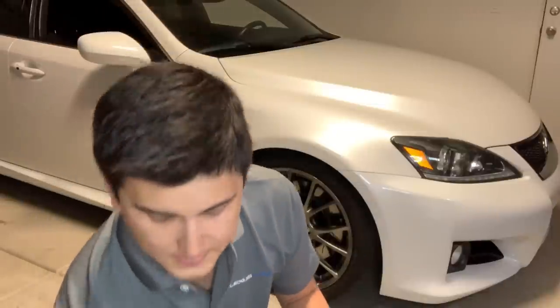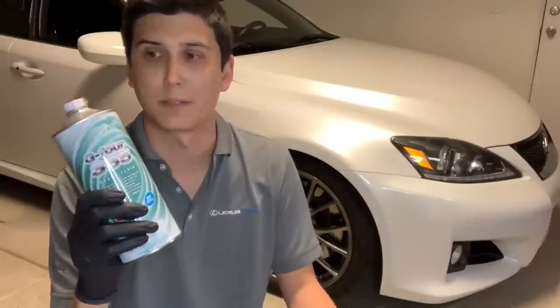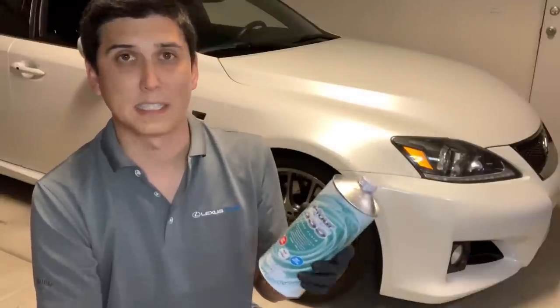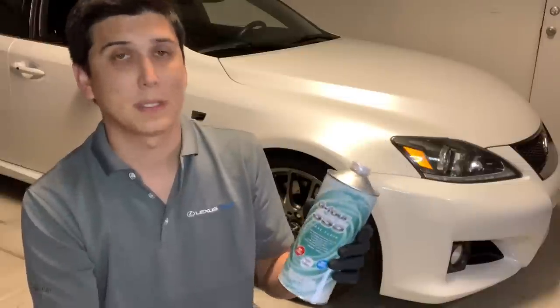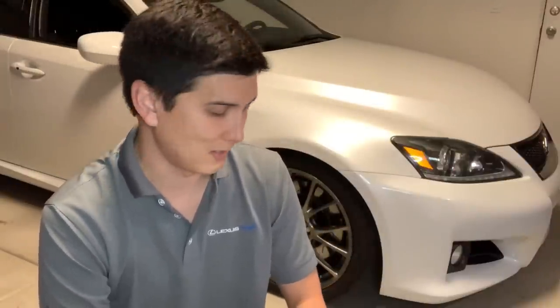I'll be doing that this weekend along with the new brake fluid. I know I won't notice any difference on the street, but I'll have to chime in later once I take this out on the track in a couple weeks and see if there's a noticeable difference. I think there should be, because the stock DOT3 fluid currently in my car has boiling points way lower than this stuff and it's been in there for about two years. Thanks for watching — maybe I'll make videos on how to do an oil change and how to bleed your brakes on the ISF. We'll see if I get around to that this weekend. Thank you again for watching and we'll talk to you soon.